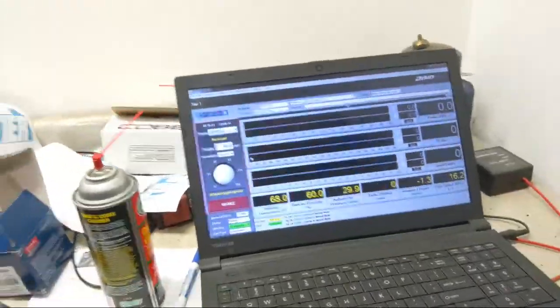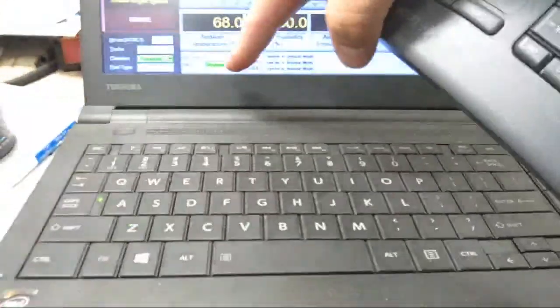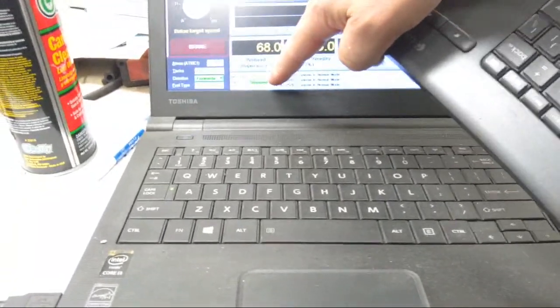All right. So first thing I gotta do. Oh, actually, right here. This is the inlet temperature, the temperature probe on the intercooler. So 47 degrees. So I'm gonna try and keep that in mind. So we put the Cobb on there and try and make sure it's at the same range when we start the test. A few degrees, not much you can do about that. Got my cable. Can't do much about a few degrees, but definitely going to try and keep it as close as possible. But you know, ambient air changes throughout the day, and that ambient air is what that 47 is representative of.